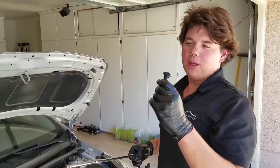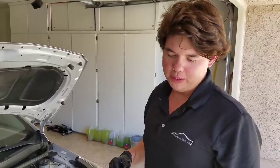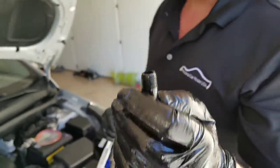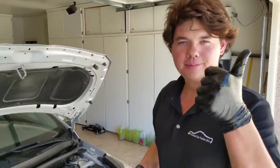We're gonna put our fill plug back in. We just got done filling it up, and we lost about 0.2 quart of spillover. Basically what happened was, when you put this in, it's such a small little hole, because that's what it threads into. Basically, if it seals off the tip when it goes in, it won't allow air to pass by. So you have to stick the tip in about a third of the way and pour it very slow so air can pass by. All right, we're gonna go ahead and cork her up, go drive her, and we'll be back to do the double flush.